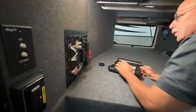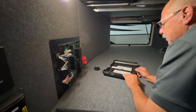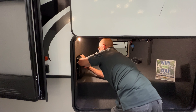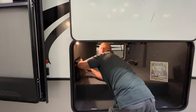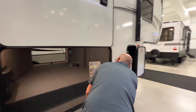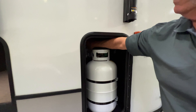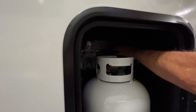This is the brains of your InCommand system. These are all your relays and everything which runs with it. You'll run everything from up front. If anything ever fails on that panel, you can come in here to the switches and it'll be selective to slides, air, or whatever — you can put it to your right setting and manually run them in and out right here. You also have a battery right here, a little watch battery — you ought to change that about once a year. You also have fuses in here to look at; they're just inline fuses.